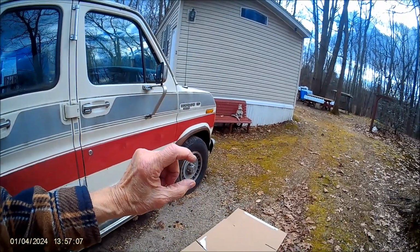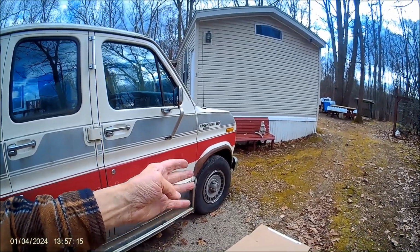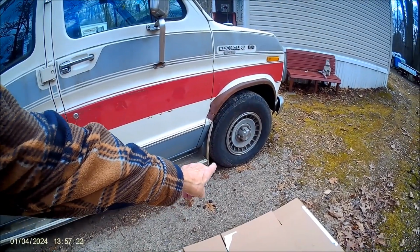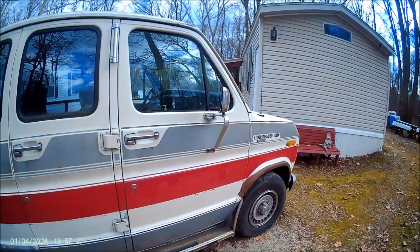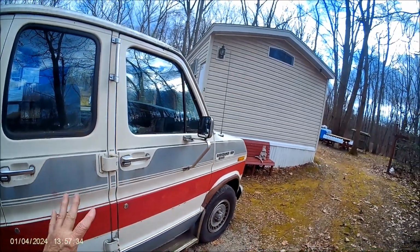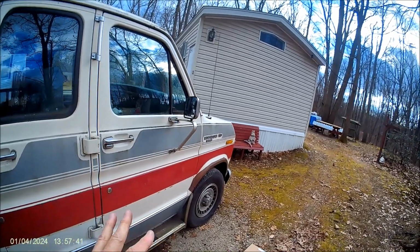There's only a little lip. It's all made out of angle iron. Good ramps will get me up about 8 inches or so. So I'm just going to stick a couple of 2x6s in the back and just back the van up just a little bit. And what I want to do is spray the starter. Now, I've had starters replaced all the time in here when it is cold. The starter will spin out. The Bendix will go bzzz, bzzz, and eventually it'll kick in.